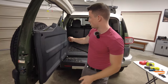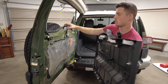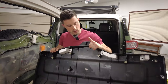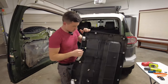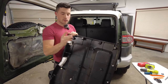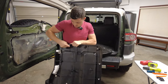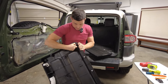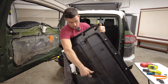Okay, that's all the clips. There are ones in the middle here as well. Now the door skin will just be hanging - what you want to do is just lift it up and off and over that rear window latch. That's partially also why you need that window open, so you can get this off. Now that we have the door skin off, what I'm personally going to do is pull all of the clips out because I want to be able to lay the door skin flat on the ground. If you don't pull the clips out, you'll crush them - which I might have done the first time. So don't do what I did. Just pull all these white clips out.